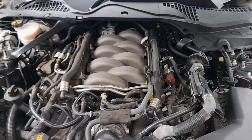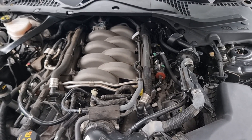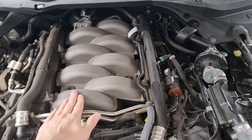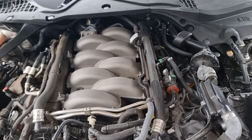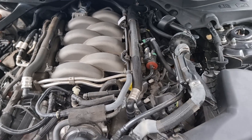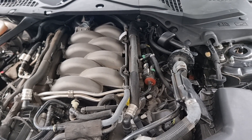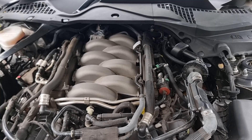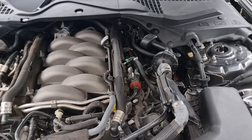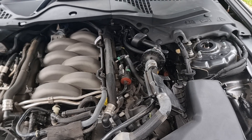This is much better than the wideband feedback system. You still have the wideband though, so it will correct for any short-term and long-term fuel trim errors. With direct injection there's a small volume in there, but within about 30 seconds you've emptied all of that and it runs beautifully. You can fill a tank up, put your foot into it straight out of the petrol station, and it'll match exactly what you commanded — that's how confident we are with this system.